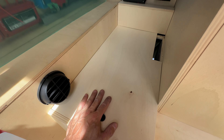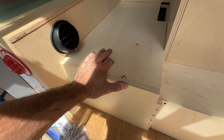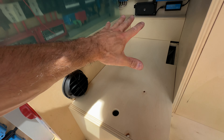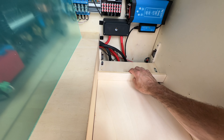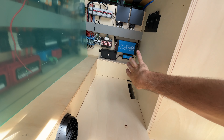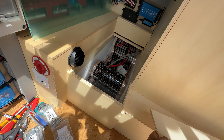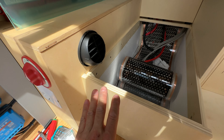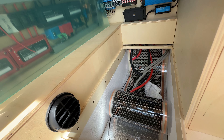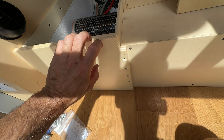About the battery — as I told you in another video — the battery is going to be double capacity. I bought eight more cells that are going to be in parallel with the existing ones. I built the cabinet so the battery will be protected; this side is just on with magnets as protection for the wires. The slot is for the cables for the inverter that is going to go here, and I can slide this out to have access to the battery. Instead of building a box and then putting the box in, I made this wall and screwed it in with a lot of screws because it's going to hold the weight of the battery.